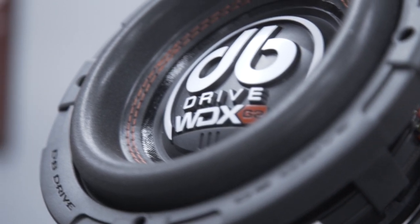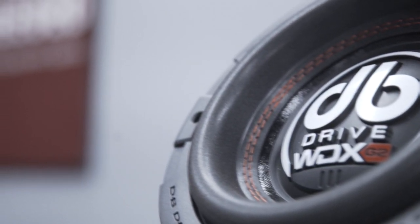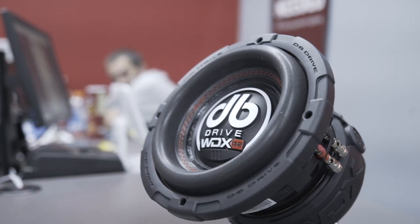It offers more peak potential excursion — peak to peak is 35 millimeters out of an 8-inch driver. Priced at under $129, that is absolutely ridiculous. These subs look awesome and fit perfectly in trucks. The most popular application is under the back seat of a pickup truck, where you typically get 1.6 to 1.9 cubic feet — perfect for two 8-inch subs. Put them facing forward, blow the port out the side, tune it to 34–35 Hz, and let it rip. People who've replaced their 10-inch and 12-inch pancake subs with these have never looked back.